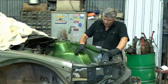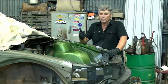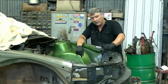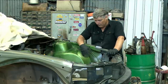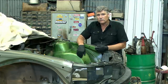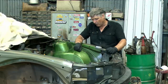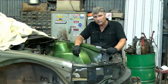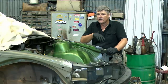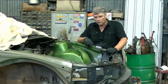If we start sanding this area now and we've got remnants of grease, we've got air tool oil that spits out and things like that sitting on the surface, we've also got sweat from our bodies sitting on the surface as well. If we start sanding all that in there, we can actually trap some of this material in the little scratches from the sanding. And then when we go to paint over it, we could have a delamination or a bit of a problem where the paint wants to react to the oils and greases underneath it. So it's a pretty important step to go around and give it a good wax and grease remover and clean it off. And it's important you put a bit of time into it as well.